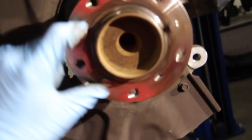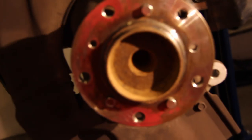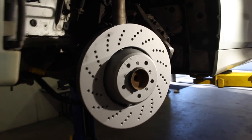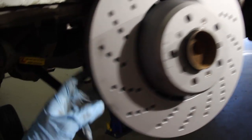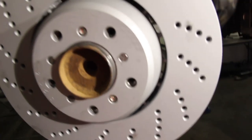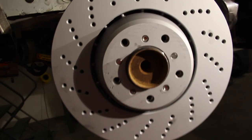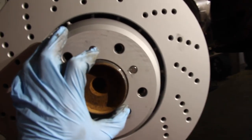Let's pop the new rotor on. There are three little pegs here - the rotor only fits one way. These pegs fit into holes on the rotor, and then there are two additional holes for the rotor set screws. Match those up and press it on. A couple of things: these front rotors are not identical. You want to make sure that the fins are the right way - the fins on the driver's front corner, on the left my finger goes down and on the right my finger would go up. So they are directional - make sure you're doing a direct replacement for what comes off. Then the ECS stainless screws went in beautifully. I put a little bit of never-seize on the hub - that'll just make this easier in another 13 years and 100,000 miles. The ECS screws are a 6mm head instead of a 5. You don't need very much torque on the set screws at all - just put them in hand tight with the ratchet.